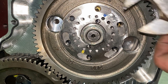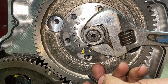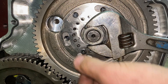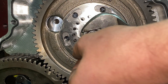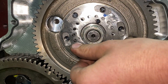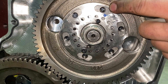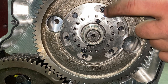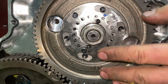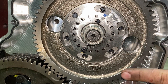Take your wrench, shine a nice light on it, and turn until you can see a hole that lines up. Right there — the hole lines up. It's at 18 degrees now, which I believe these gears are advertised as having about 40 degrees of sweep. Counting the holes I think it's about 34. That puts us right in the middle of the gear, so you know you're doing pretty well with your math. I'm going to tighten this up, put the other bolts in, tighten that down, and she's set at 18 degrees.